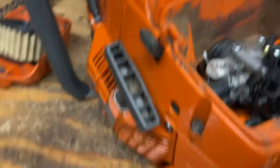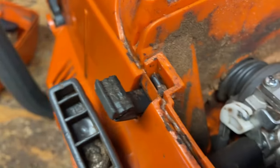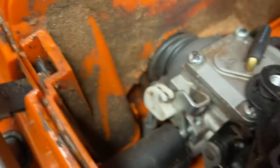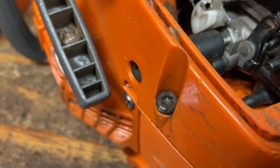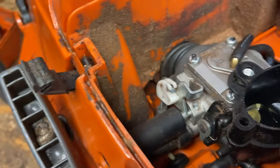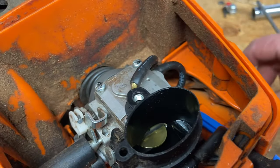Take your top cover off, air filter off — here's your throttle. Normally this line is attached to the throttle, so if your throttle butterfly or lever isn't coming back to the idle stop — it does right now. If I take the line off it still does. If you hook the line back up and it doesn't go down to idle, then you know you have a problem with your throttle cable, like this one I showed you that's worn through and making it hang open.